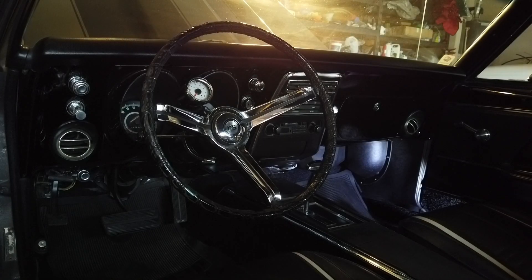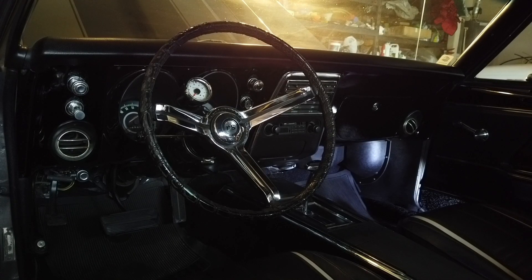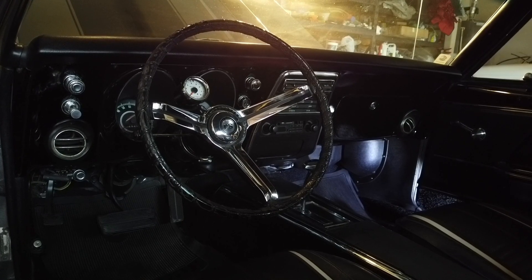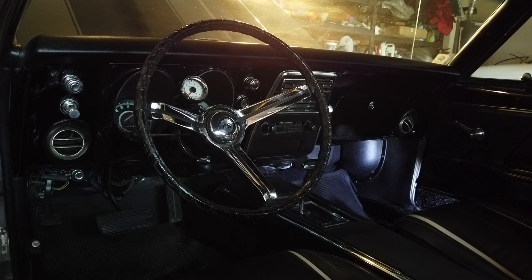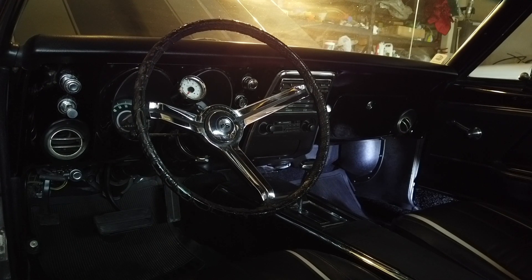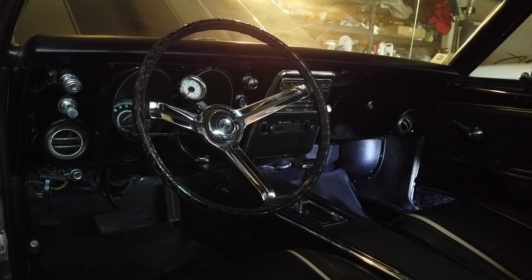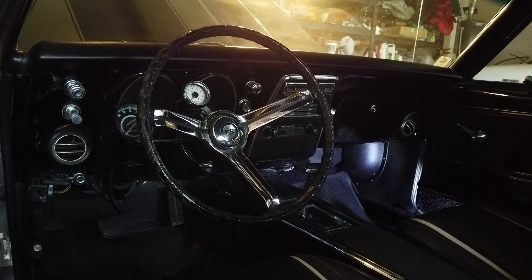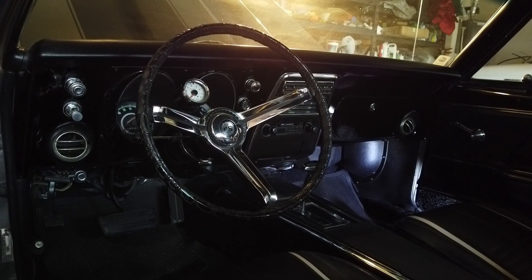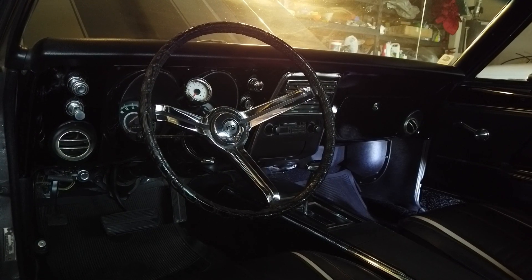So this is what the inside of the car looks like at the moment. It's a little dark — it happens to be a rainy day. This was an original factory air-conditioned car, so it has the vents for it, but I decided I'm not going to use it. None of it works because the compressor went bad, the tubing and hosing was all rotted, the ducting inside the car was completely rotted out, the plastic crumbled into little tiny pieces, and the fabric flex hoses basically turned into dust. I have all the stuff still attached to the car because I decided to leave it on just in case I decided to try to put it back together again, but I never did. So now the problem is when I could have gotten rid of all this stuff before, I didn't, and now it's all in the way.